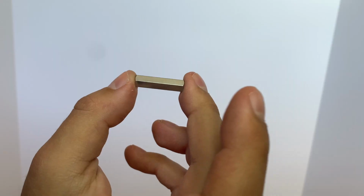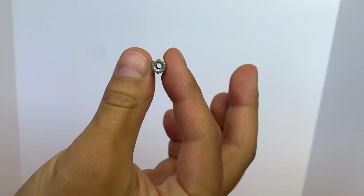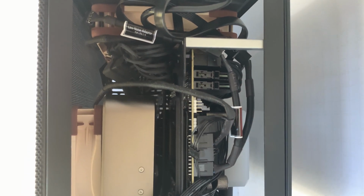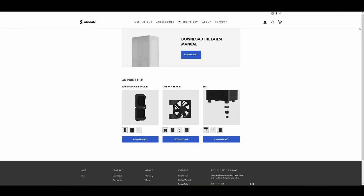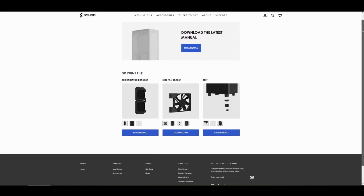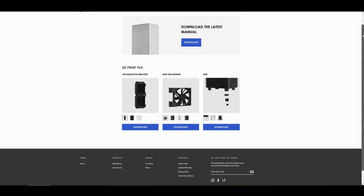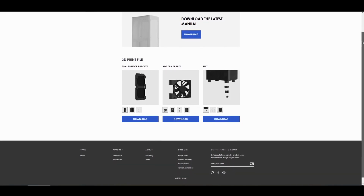I did make some modifications since we filmed that montage. Firstly, I added a longer standoff between the case and the PCIe riser cable. This allows the Founders Edition card to utilize its unique flow-through cooler design and really help temperatures. Second, in addition to the standoff, I added a fan, supporting that flow-through design. I've also added some 3D printed feet from Sunnyside Up, or SSUPD for short, I guess, that allow for more heat to escape, and the ability to use a normal DisplayPort cable.